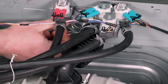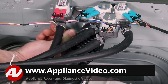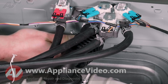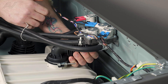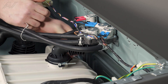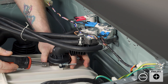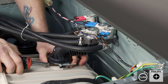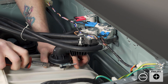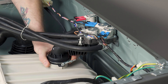Now in order to replace it, first we have one clamp on the back. You will pinch it with your fingers and just start to pull it off. Then you'll grab the hose and pull it off the back. Then at the top, you just have one Phillips tip clamp. This works like a worm clamp — twist it off and loosen it.